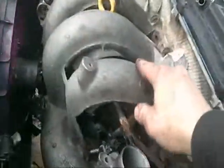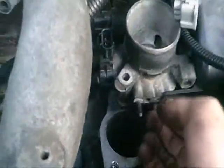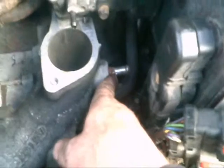Okay. Unhook the manifold. We gotta unhook the 2 13mm bolts here. There's a 13mm bolt down in here and a 15mm bolt way down in the bottom, which is still being a bitch. Okay, unhook the fuel rail, fuel lines. Unhook the bolt from here, unhook all this. I got all my bolts out. Everything should be unhooked. Let's see if we can pull this puppy out now.